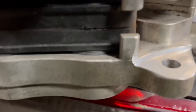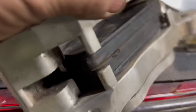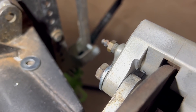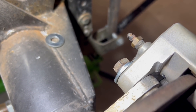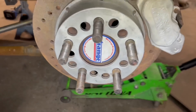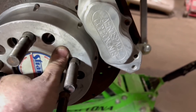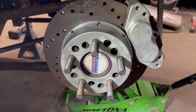Alright guys, here is my professional machining — we did that with a flap disc on a side grinder. It's pretty close, mostly even, knocked off about 90-ish thousandths. Let's see if it fits. We got one side done. You can see the spacing is pretty close to center, so we did have to do some good grinding on the bracket to get it to fit. I'm not sure if this brake caliper bracket is aerospace or not — I've never seen an aerospace one like that.